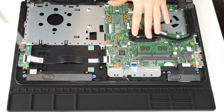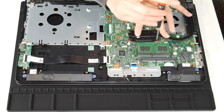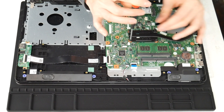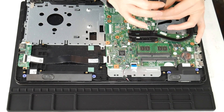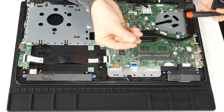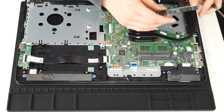Go ahead and put your heat sink back on — there are four screws, and it is kind of like putting a tire on. You have to go one screw and then across to the other screw at an angle, so that you don't get one side tighter than the other. Also be careful not to touch the motherboard with the oils on your hands — don't get touchy with your motherboard. You'll regret it; the oils on your skin can cause problems. So hands off, people.